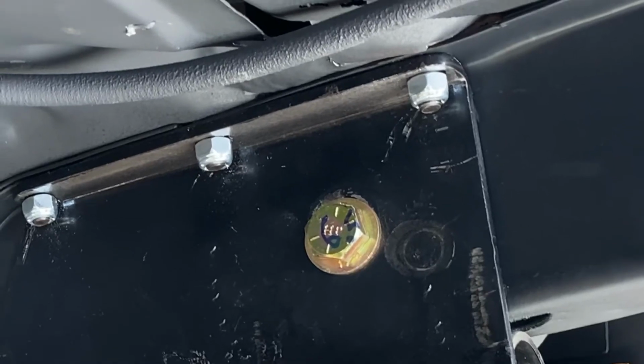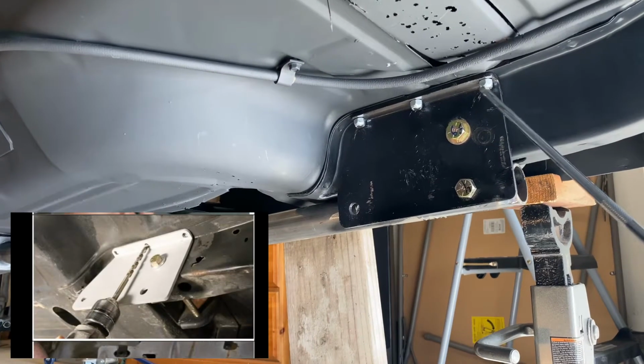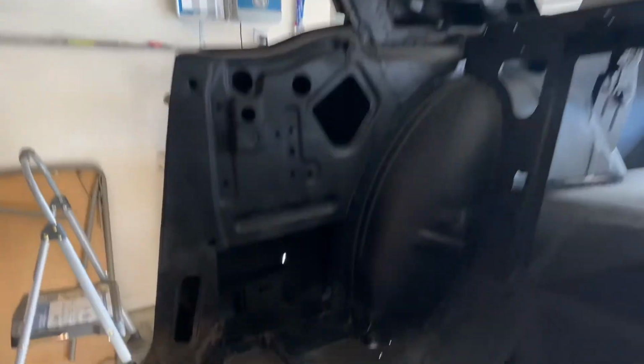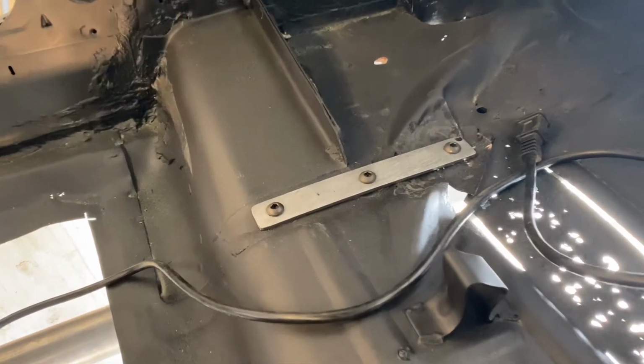Pick 3, same page. Get ready to drill some holes on the top to install those 3 small black bolts, sucking and putting this plate up to the proper position for the rest of the install a little later on. Pick 4. On top in the cab, here's a picture of the subframe support plates. I had to do some hammering inside of the cab.